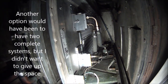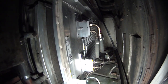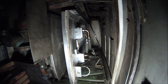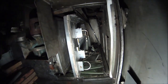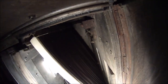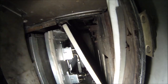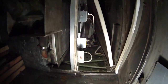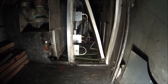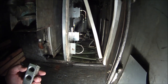It's not the ideal situation — these two evaporators together are worth about 80,000 BTUs, but our condenser is really only a 60,000 BTU condenser, so there's a little bit of an imbalance. It works at about 75%, but it works okay. With the filter in, the air is returned to the HVAC from the top on the right side, goes through the filter, through the air conditioning coil, and then through the heater core. This is basically the way it was set up originally, except the lines weren't like this and there was a much bigger evaporator. It weighed a ton, and when you turned it on it felt like you were dragging another car behind you.